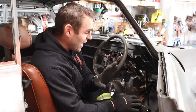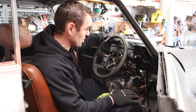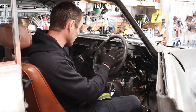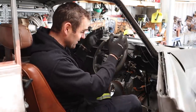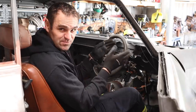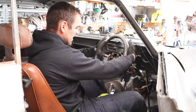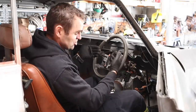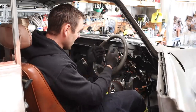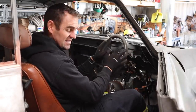Before I go too far, I'll just bring the dash out and have a look. Thankfully when I bought this car, the dash was the nicest thing — he had just had it retrimmed, so it's a nice fresh crispy clean dash, which is perfect and I don't want to modify or change anything. I realised the steering wheel wouldn't have been in line with the gauges if I'd left it offset, so I have to put it back in the factory steering spot even if it is slightly offset to the driver — that's just how the cars were. What I've done now is realign everything. I'll probably need to get some sort of dish steering wheel, or whether I can get away with a removable steering wheel or something along those lines. There are methods to get the steering wheel a little bit closer, but we're within the realms of usability now, so we can try and start making it all fit.